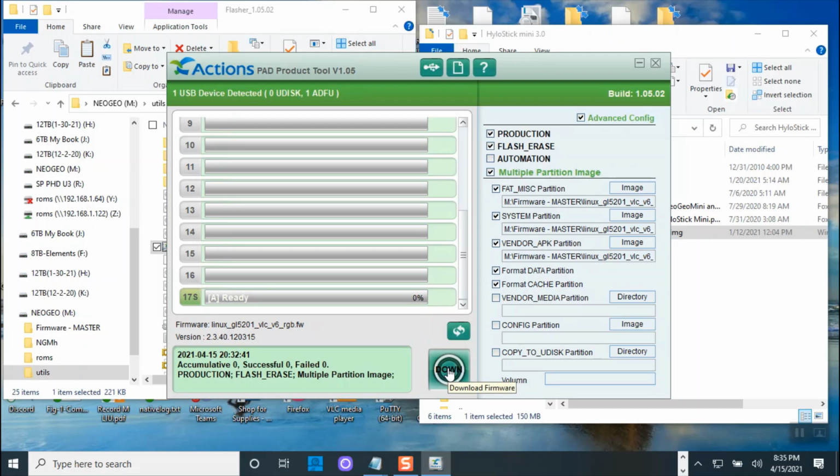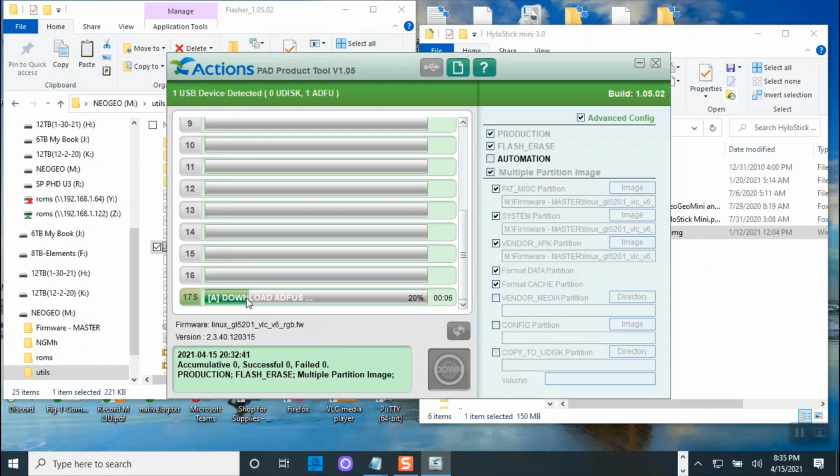Okay, let's try to flash this. I don't know if it's gonna work on mine because the file is a little bit bigger. Now, once it reaches past 30%, that part I remember because I do it so much. If it passed 30%, then you're good to go. But if it sits there at 30%, yeah, see, if it never reached 30%, that means it will fail. And it says partition overflow because the file is too big. Too big to flash.